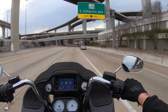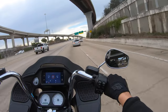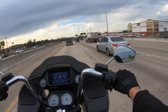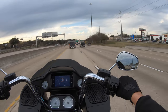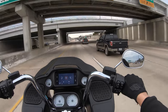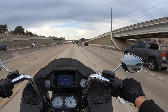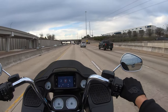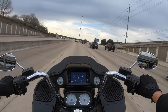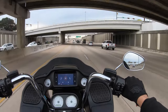For my tuner I went with the FP3. Just a heads up: if you're ever going to install an FP3 on your bike, I recommend you wait and install it while Vance & Hines is open, so if you're running any issues they'll help you out right on the spot. I installed mine on a Saturday and the FP3 failed — it wouldn't transfer the map, kept throwing errors, and it bricked my ECM so I couldn't even start my bike.